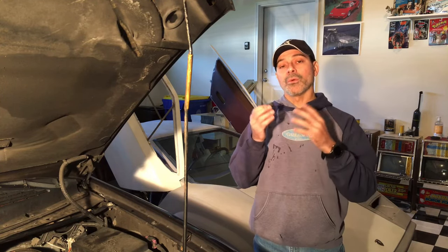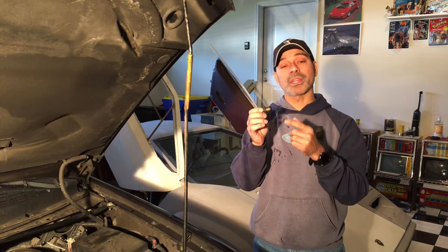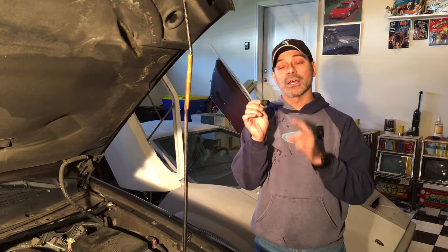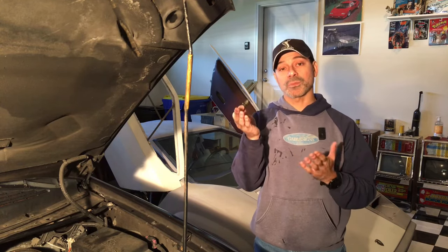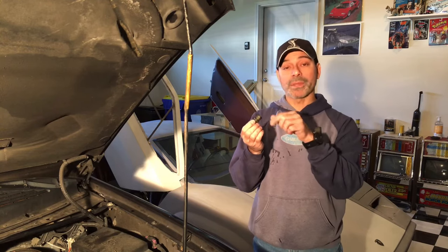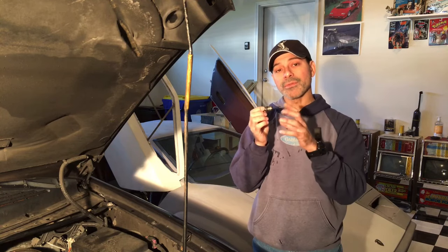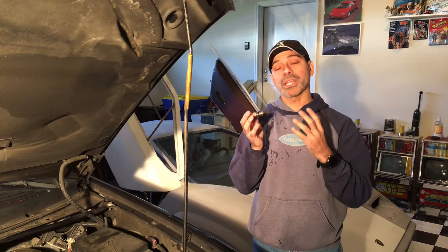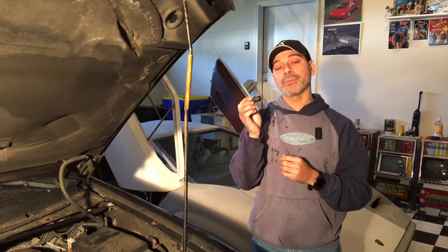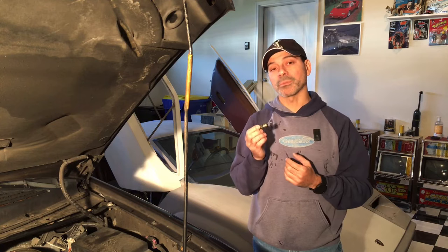It's not a bad idea when you're doing routine maintenance to just pop it out. As we saw, some of them are screwed in so you have to unscrew them, but a lot of them you can just slide right out — on General Motors vehicles especially, they just slide right out. So it's easy to check it, take a look, and make sure the valve doesn't have any junk caked around it, because these need to be functioning properly. A lot of times when you check them it's just as easy as cleaning them.